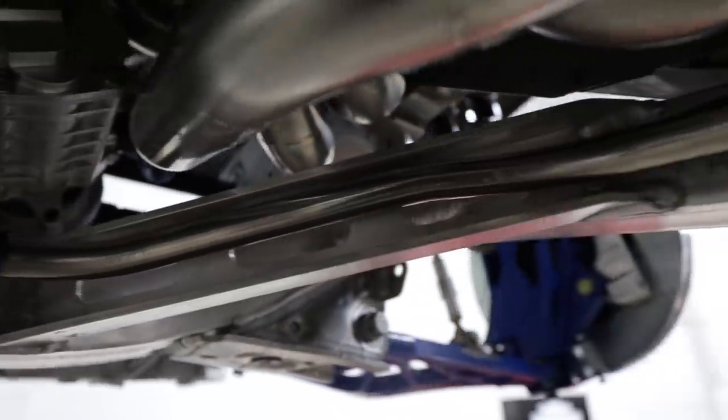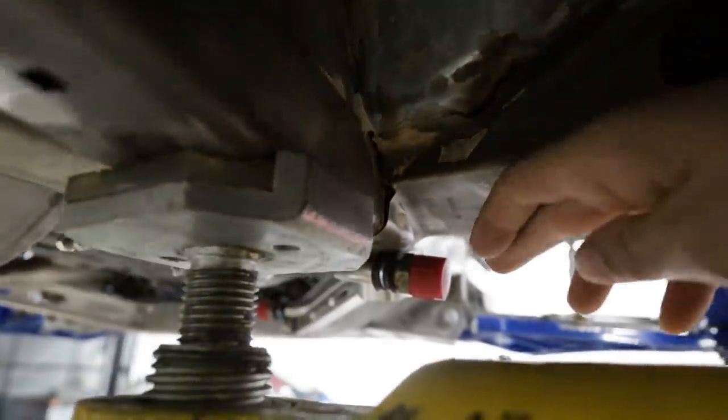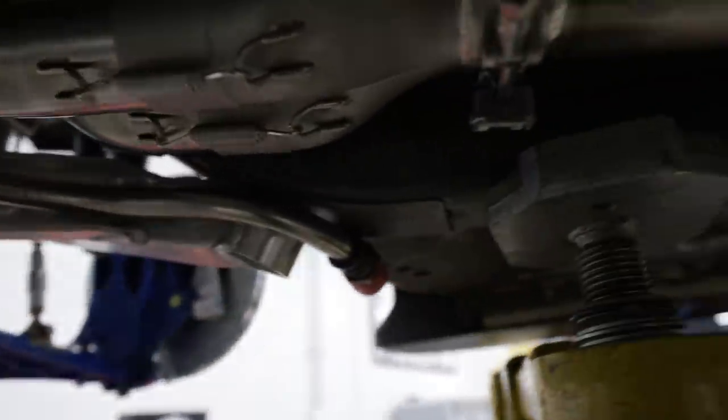The first part of the oil feed line, which we're using a stainless steel hard line for, is finished. Dom's got the dash 12s welded on. Just using P-clips to hold it on the chassis. And then we're gonna run a 90 off of the bottom of the oil tank. And yeah, 90 here, 90 here. And then run a straight off of this all the way up to maybe a 90 or maybe something. We can find a specific fitting to help run that down here. Put some heat management on here eventually. It'll be looking good, baby.